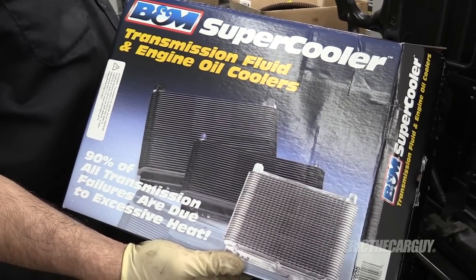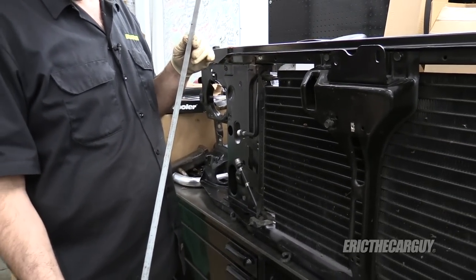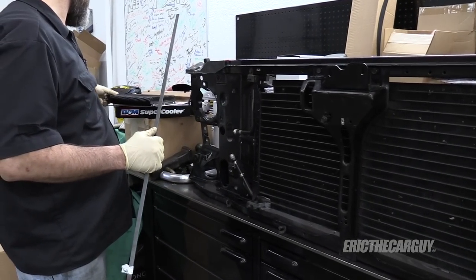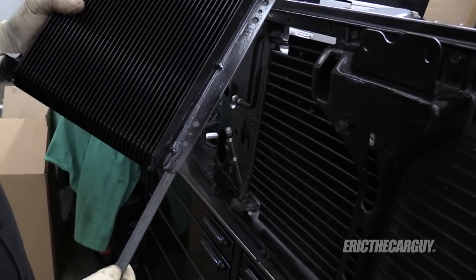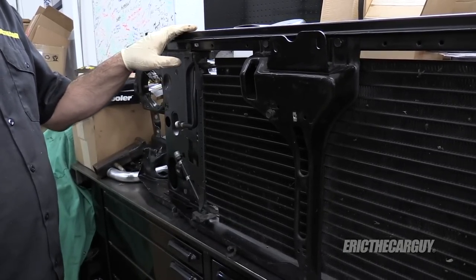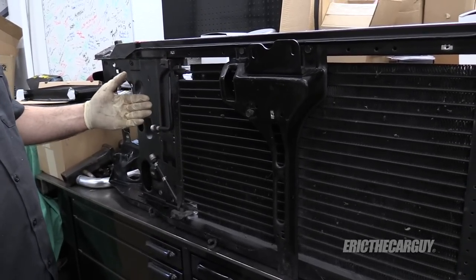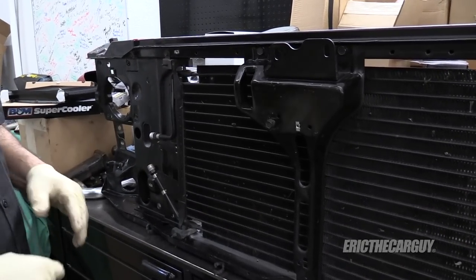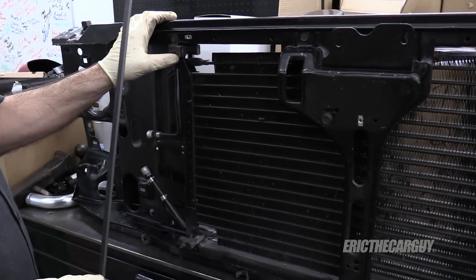This is the cooler I'm using and I got it from Summit — I'll link it in the description. I went digging through my scrap and found some eighth-inch by half-inch steel that I think is perfect for this. It does have a little flex to it but I'm not going to be too worried about that — it's like the perfect size and seems to match up with those holes. Whenever I fab something, serviceability is always in my mind. I'm thinking one day I may have to remove this condenser, so this needs to be removable. If I make it so the transmission cooler is not removable, I'm screwing myself if I end up needing to replace the condenser.